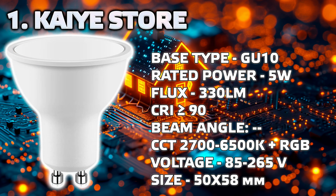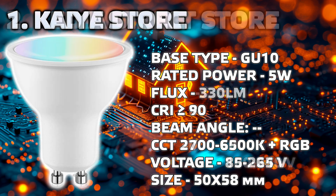There are some parameters common to all concerning the base and declared power, so I will not mention them. For the first bulb, a luminous flux of 330 lumens and a color rendering index of at least 90 are declared. The range of color temperature in white mode is from 2700 to 6500 Kelvin. I did not find data on the angle of the light flux.